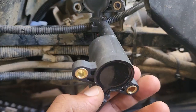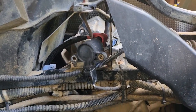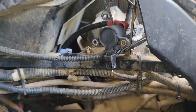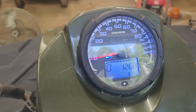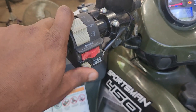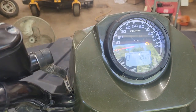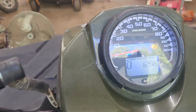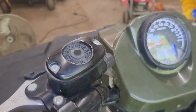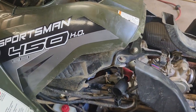Both ohm out the same, but when I put the new one on, the error code is gone. I've already gotten it running — I had the new one in, then put the old one back just to make this video. Again, error code 1268, engine light flashing. I was able to access the error codes by pressing this button repeatedly until the check engine display is on screen, then holding it down until it starts displaying the codes. From there you can shut it back off, change out the module, and everything is good.